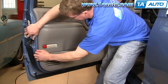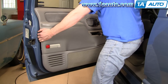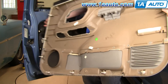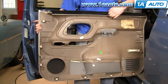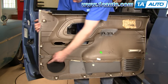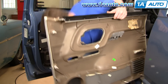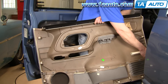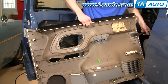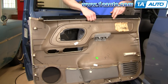Once you've released all the clips, the panel lifts up and off. Here's what the back of the panel looks like. Here's where all the clips are — this being towards the front of the car, there's the speaker. You get three clips up here — one, two, three — four on the bottom, and then one, two on the back side. What you're doing is working the knife right in next to the clip and then pulling them, so that you're pulling on the clip, not possibly breaking your door panel.